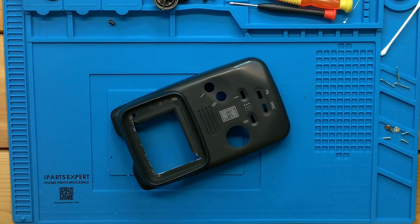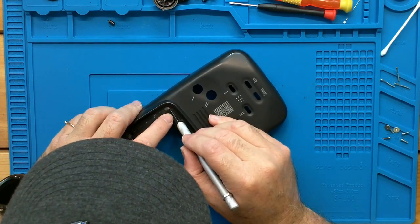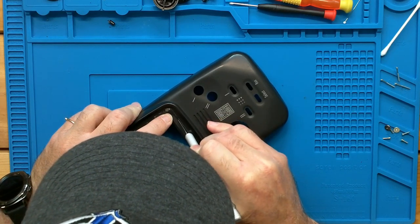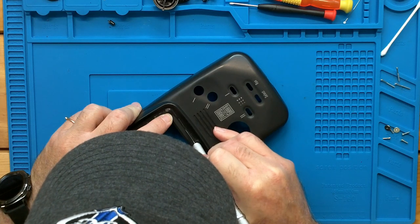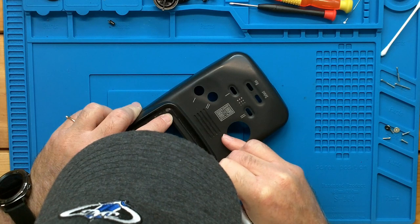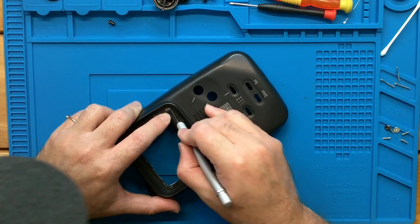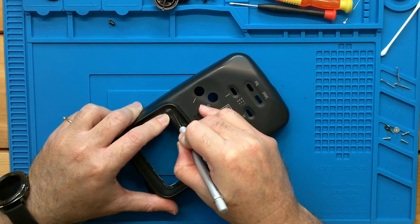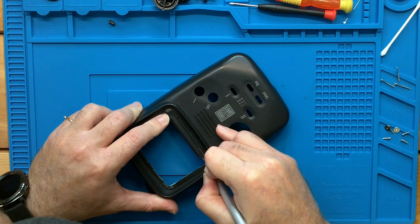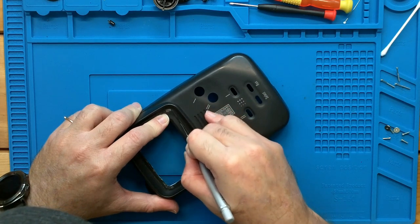So our mark is already there. If we come in just beside it and use a very sharp hobby knife, we can draw a second line. Not the whole way across, because we don't want to hit this side of the case. But now that we have that track in place, the knife will stay in that slot. And I'm using quite a bit of pressure. Okay? So if you drag it through a handful of times,